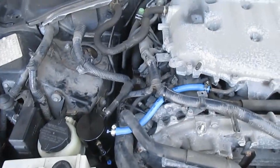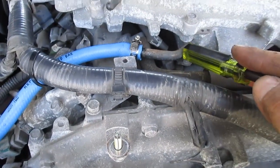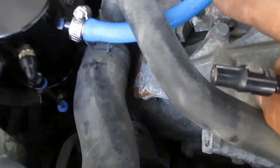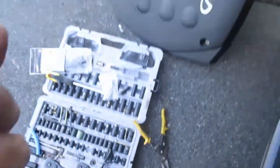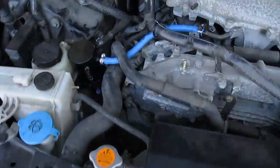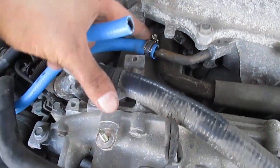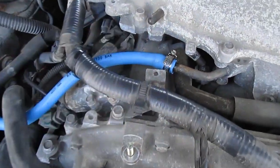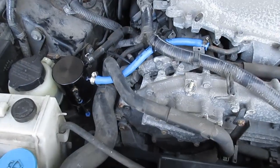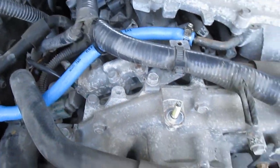When it's all said and done, you'll have a system that looks like this — coming out of the little nipple into your oil catch can, and then back into what I believe is the PCV valve or something. Correct me down in the comments. One thing I would recommend is getting a bigger hose. I'm not 100% sure what size hose this is, but when I go back to get a black piece of hose, I'll make sure to get one size bigger, because this was kind of difficult to get on. I am over the little flare here so it's not going to pop off, but I had a little bit of trouble getting those on there. One other thing I'd recommend is just a zip tie to keep this up off of the timing chain case — you don't want that to melt. Even if you get a gas line, it should be able to hold up to that heat.